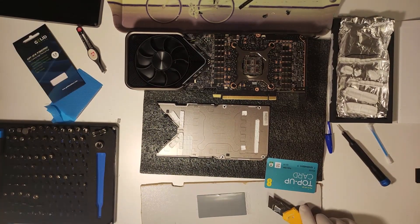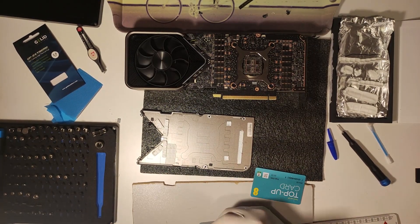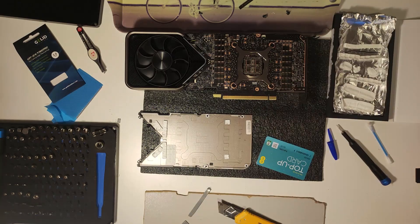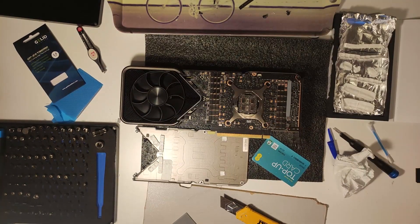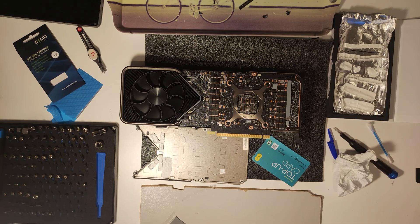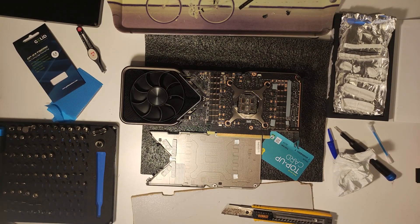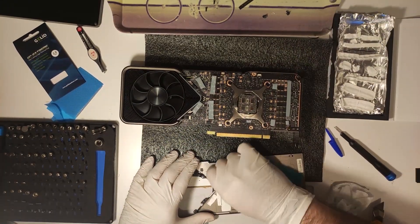You will need to take off the PCB again — this is where the advice to not use MX-5 comes in. You will notice that the thermal pads are all indented from the components squishing down. Gently use a very flat object — I used a small pocket mirror — and apply even pressure on all the thermal pads. Using a piece of glass or mirror on top, with a vernier measuring a couple of points of depth at the bottom of the cooler, very gently squish them by about 0.2mm. Reassemble and retest. If temperatures have improved but are still over target, open the card back up and squeeze the pads another 0.1mm more. That should finally do it — but be careful not to go overboard out of frustration, or you'll be right back where you started with the pads separating.